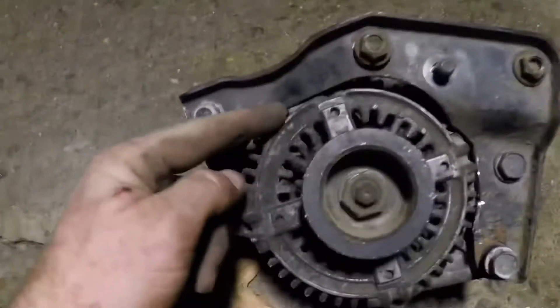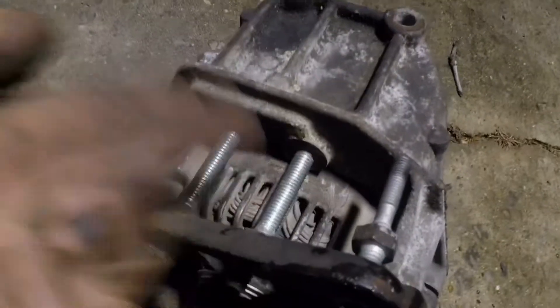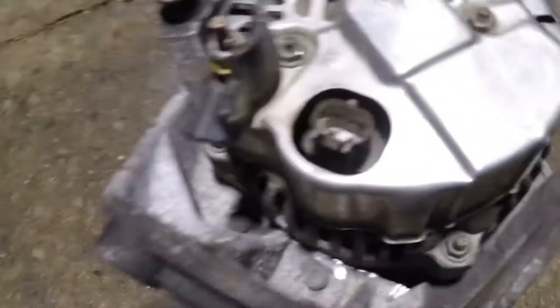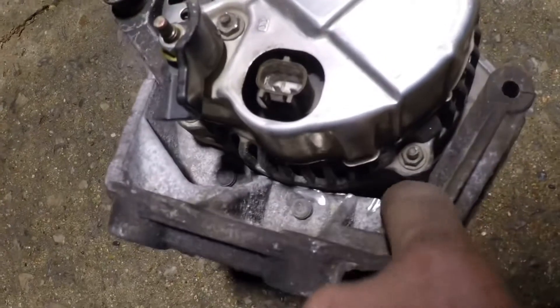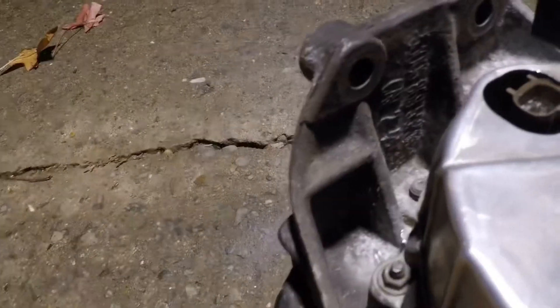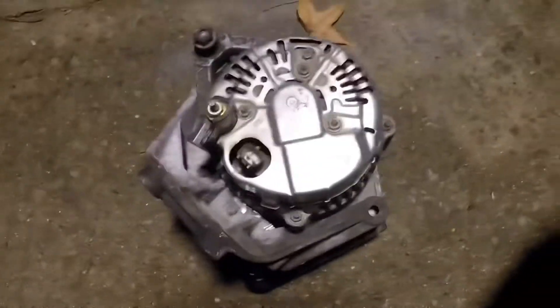It's starting to thread - I'd say that's job well done. For last reference: you cut here, you shave right there from the front perspective, that's all you really have to do. Then you trim down what's on the bottom side of these two bolts enough to get up against the alternator. As you can see in this shot, you can see where I trimmed back up in there. I notched this - I now see I didn't really have to - just make sure you smooth out your cuts where there's not a crack forming. Where this thing swung inside these little bolt ribs, I barely notched it so it would fit into the groove, and here it is - it fits.